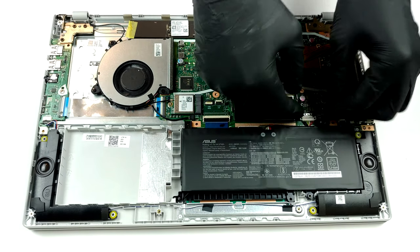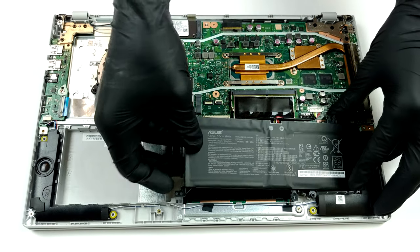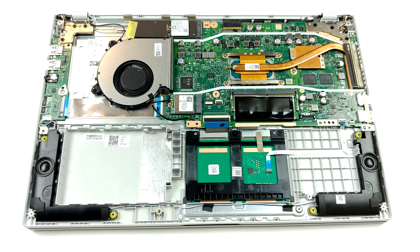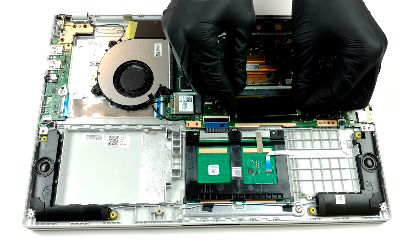On the bright side, it takes some heat away directly from the heat pipe, the chips, the video memory, and the VRMs. Sadly, though, this means that air that is no longer cool reaches the heat sink, and the thermal efficiency of the entire setup is compromised.